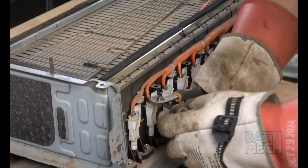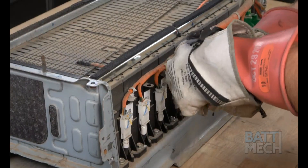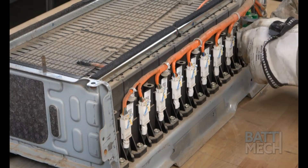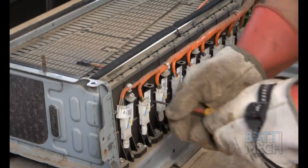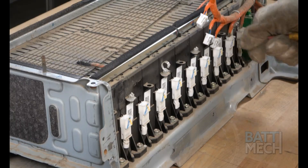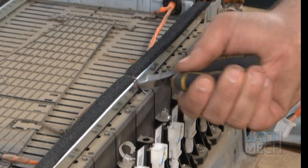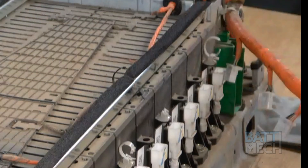Next, proceed to the other side of the battery pack and clip off the white plastic zip ties. Keep in mind, you will secure these orange wires during the reassembly with new zip ties. It's also important that you do not cut into the orange wires, as this will result in a large spark. Once the zip ties are clipped, continue by unfastening the white plugs as shown. Now, move to the top of the battery and clip the zip tie that you see here. Be sure you have a few small zip ties on hand for the reassembly.